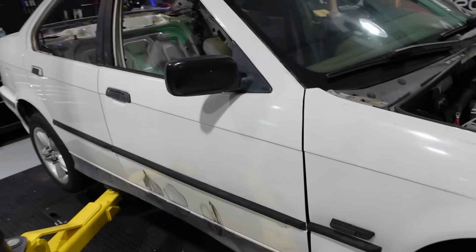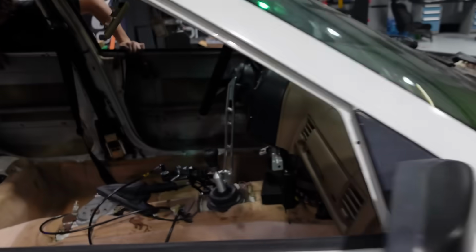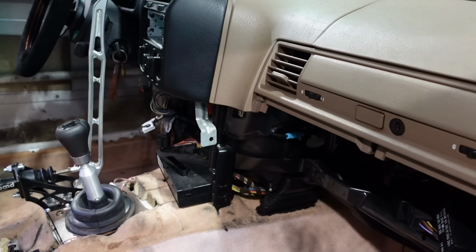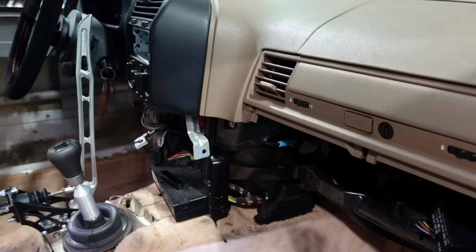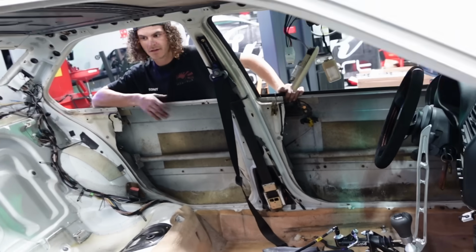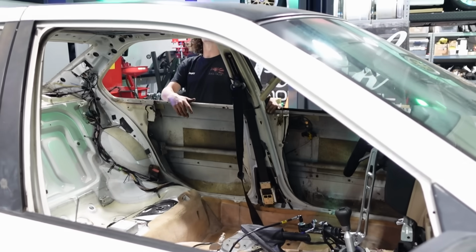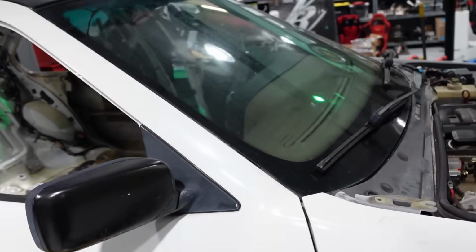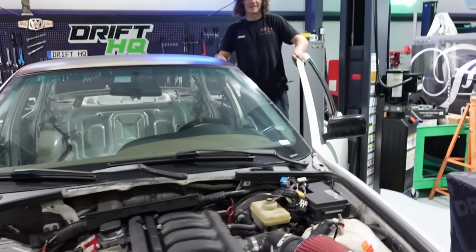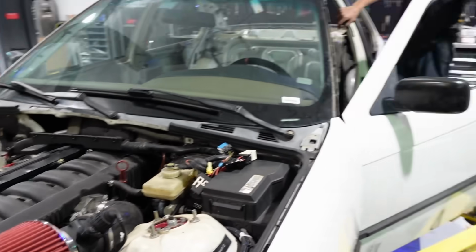It's kind of an extreme level of cutting stuff, but at the same time, we did not pull the dashboard. So we still have all the components under there, heater core, evaporator core, blower motor, all kinds of stuff. Even the dash bar, like all that stuff we could technically remove, but for now, we're going to see what it weighs. I think we'll get under 2,500. And then at that point, Donnie said we can just start looking for random stuff that we can cut off and take off, right? Yep. Yeah, love that. Just see where we can save weight.